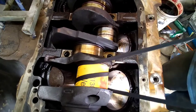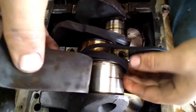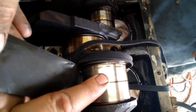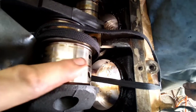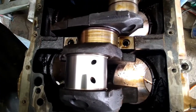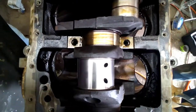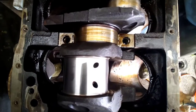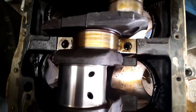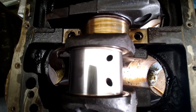All right, let's pop that off there, see what she looks like. Oh, you can see here where she's starting to come around. It's lightening the oil mark a little bit. Here we got it nice and sanded with 800. I think we're just going to jump straight into polishing. I really don't see any reason to go 1000. A lot of guys go 1000, maybe 1500, but that looks a lot better than what that does. So we're going to just polish it and see what happens.